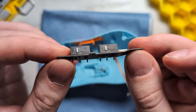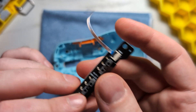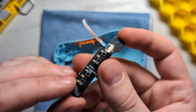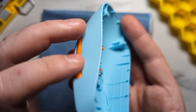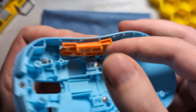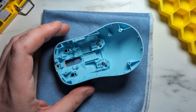We can also see the side buttons here. The ribbon cable is replaceable on both sides, which is fantastic to see. So while it is a very thin and easy to damage cable, it is very easy to replace, which is great. Next up, we can remove our side buttons. Since it is a pin design, we can just take two of our fingers, push in on the side, and just gently pull off from the side — the side buttons will come out just like this.